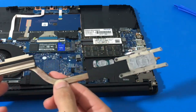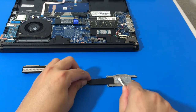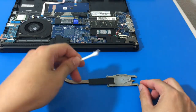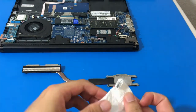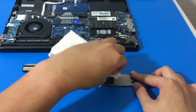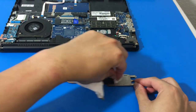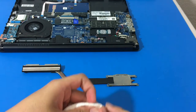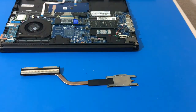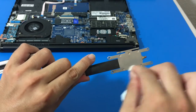We should start cleaning out the thermal paste. I'm using a little bit of isopropyl alcohol and a cotton swab, gently removing the thermal paste. There's definitely a good amount on this laptop, and we've been using it a lot for gaming, so an upgrade in thermal paste is probably what we need. I'm actually surprised this laptop has held up — it's proven me wrong many times. I don't know why I was so skeptical, but if it works it works, so let's clean it off.